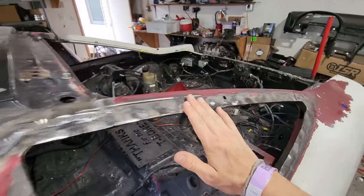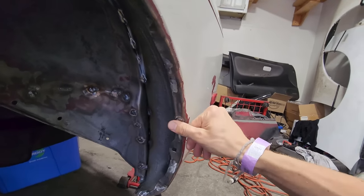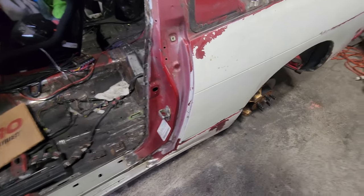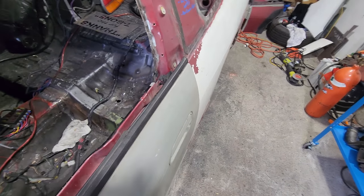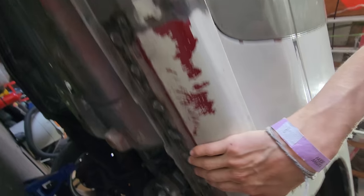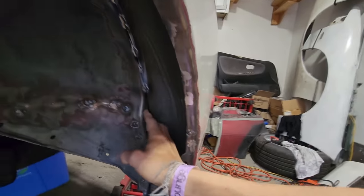That was honestly nerve-wracking being upside down grinding away these welds. But I needed to make sure I ground some of them smooth so I can fit a window on here. For rolling this quarter panel, these need to be smoothed out as well — if they're bumped up it'll catch and cause a wavy quarter panel. We did all this work, we're going to make them look nice. Check it out — door opens and closes. That's so satisfying. All this is cleaned up.